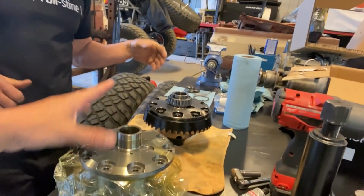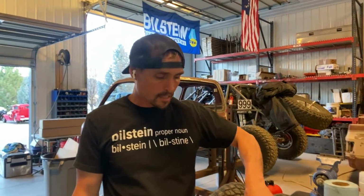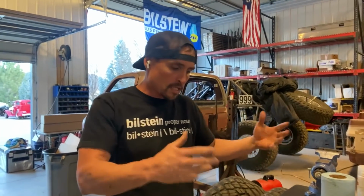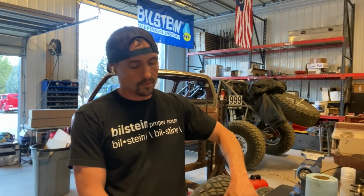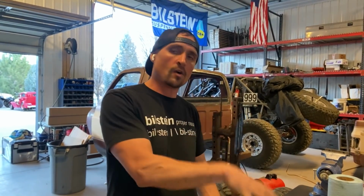That's what he's doing. He's just swapping out the whole thing. Then we'll go through and tear this apart and see what's going on inside, because it's definitely leaking, but not from the outside. It only leaks when he's using it. So if he gets it up and he's really got it torqued, it starts to leak and unlocks and slips. These things are prone to crack internally, so we're gonna see if that's possibly why. But it's been serviced like 3 times and it still does it, so something is wrong with this.